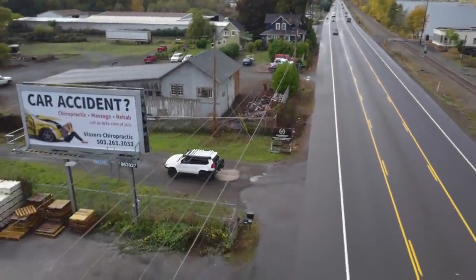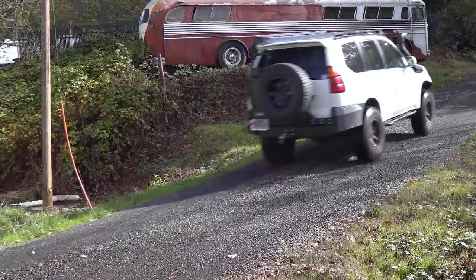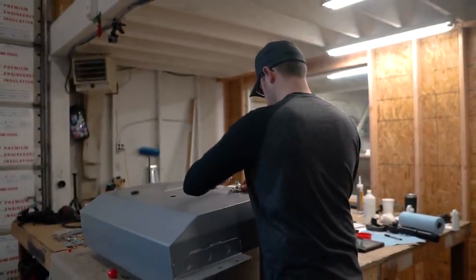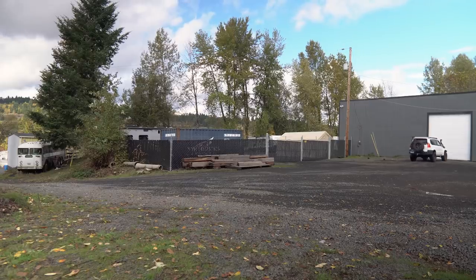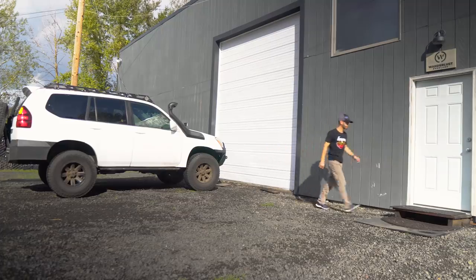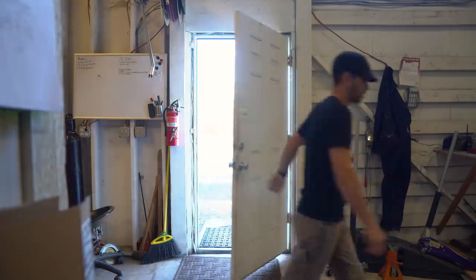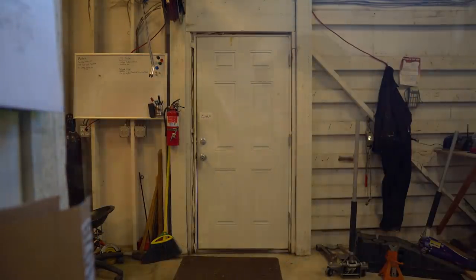It was time for the final piece of the puzzle, and one of the most important missing elements, the long-range fuel tank courtesy of Cruiser Brothers. One of the biggest downfalls of the GX was the range we had due to poor fuel capacity, and we were about to remedy this with 33 gallons of liquid go, for which we'll hopefully be seeing ranges of up to 500 miles.